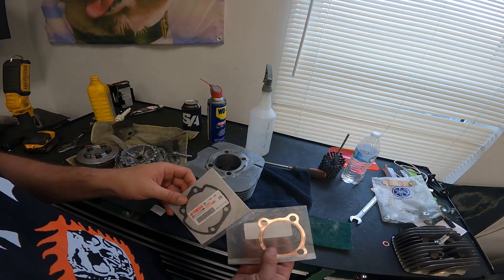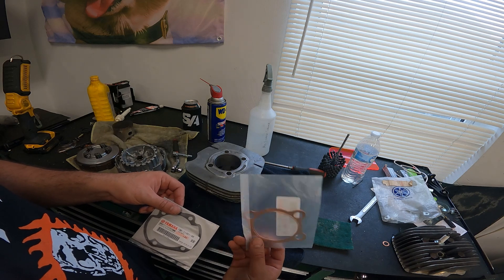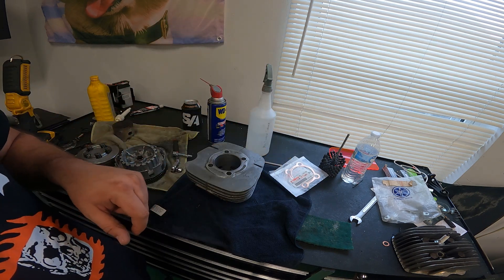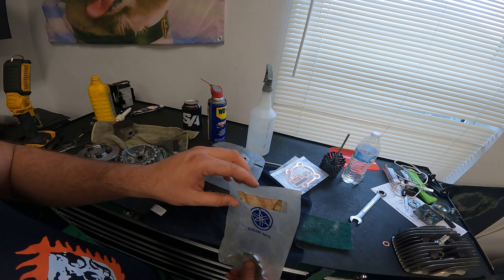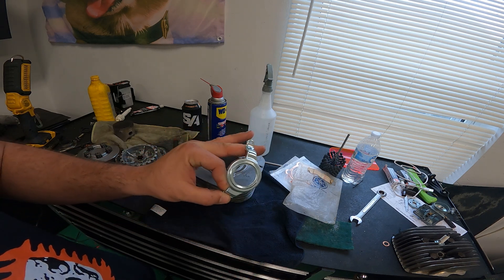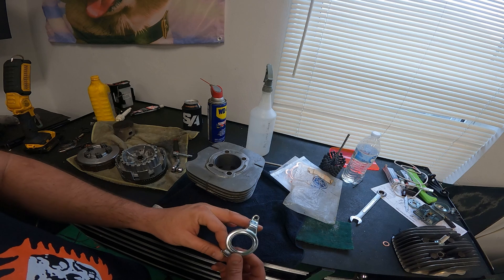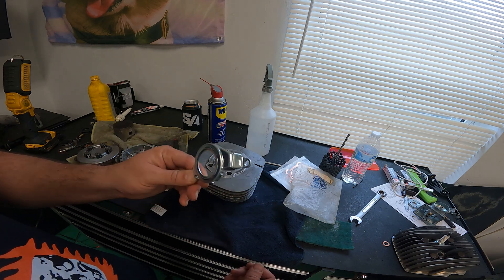It's a new day. The hone on the cylinder is officially done. I've got some new parts to put on this thing and a couple of new tools to try out. To put this thing back together we've got a new base gasket and a new cylinder head gasket. Probably didn't really have to replace it, but I wanted to be on the safe side — and it's like a $10 part. Even better than brand new OEM parts is new old stock from the 70s. At the end of last video I found the crank seal had worked its way out. Back in the day, Yamaha put out a service bulletin producing seal retainers for these bikes, and mine didn't have it. The CT175 should have had it from the factory, but for whatever reason mine was missing the one on the left side of the engine. We've got it now, so hopefully we'll never deal with crank seals ejecting themselves again.